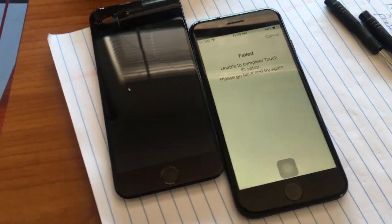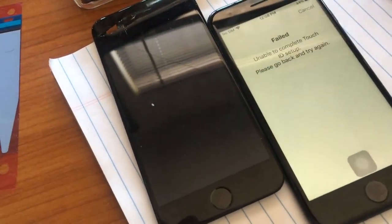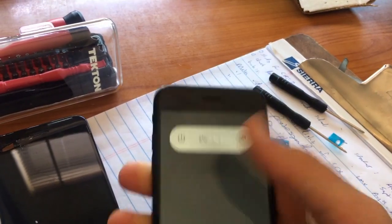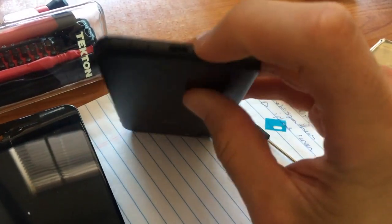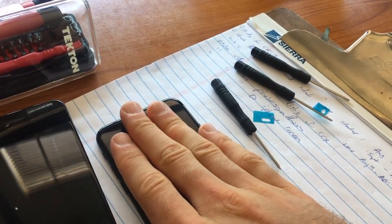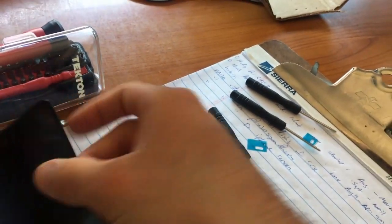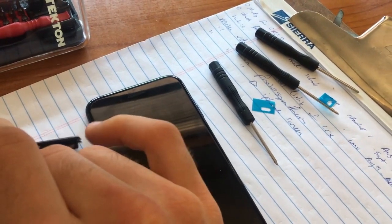This is something I just learned the hard way, and what I'm going to do here is show you how to fix this hopefully. First we're going to power off the phone. I've already tried restarting this a bunch of times and keep getting the same error message, so we just need to power off, take out these two screws, gently lift up on the screen, pull it back slightly, and then tilt it up. You need to pull the screen back because there are little plastic hooks on the underside.